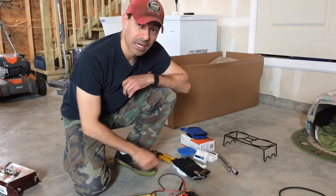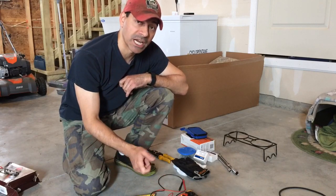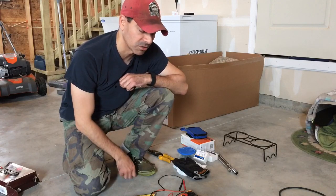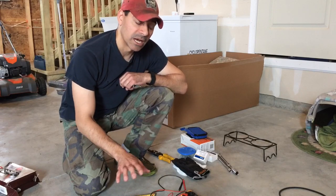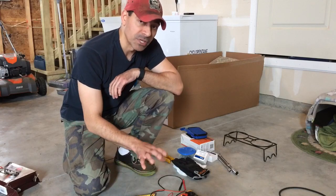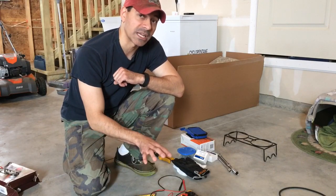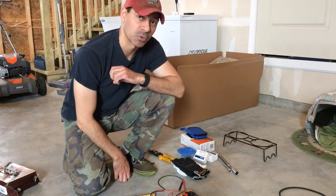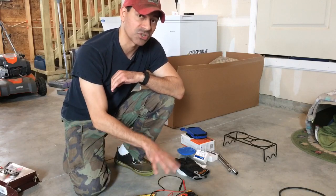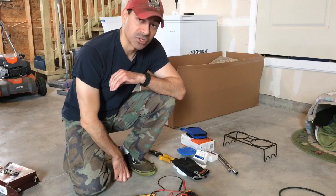I'm going to test the rest of these and show the multimeter screen so you can see the different readings. Keep in mind this is not going to be the same on every vehicle — you'll need to check the vehicle specs for the resistance rating for your particular vehicle and the brand of spark plug wires. This test just shows the process; you'll need to research your specific readings. Also, just because the resistance rating is good does not necessarily mean the insulation is good — insulation can also break down, causing grounding issues. We're not covering that in this video; this is strictly for testing resistance.